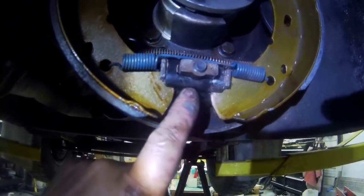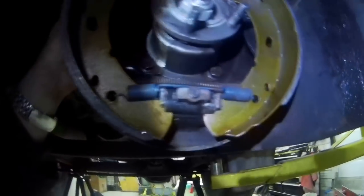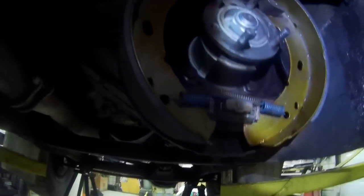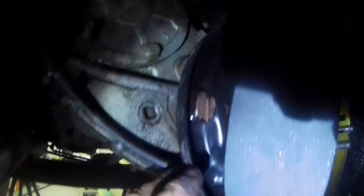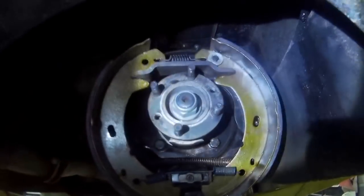So I've put the shoes into the bottom adjuster. The spring goes over the top of the adjuster, not underneath. A good little tip I would say — if you've never done this before, get your smartphone out, take a picture of it, take a picture of everything. Do that with everything that you're not really sure of because it's so easy nowadays to take pictures of things. The pin's coming through here. It's so easy — we're almost there now. I've got some copper grease on the contact points here, so it's all going to be nice and free.